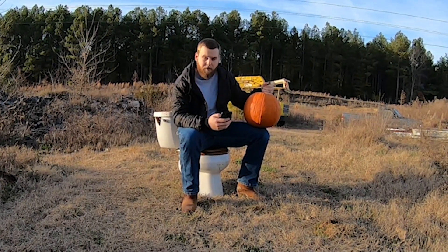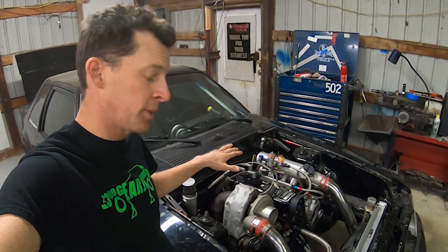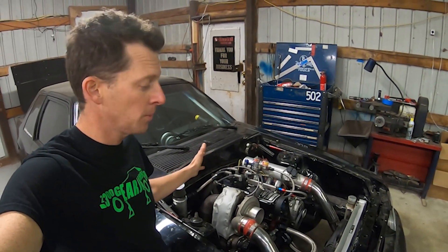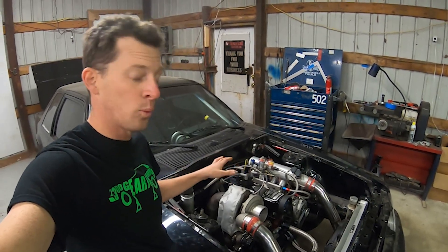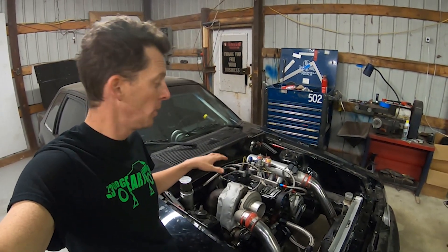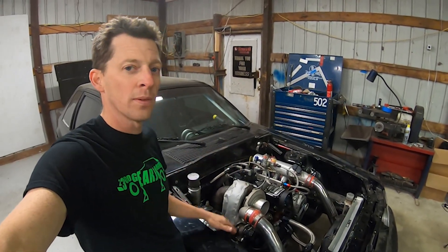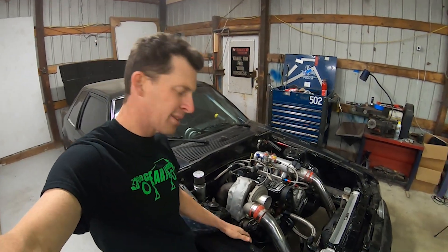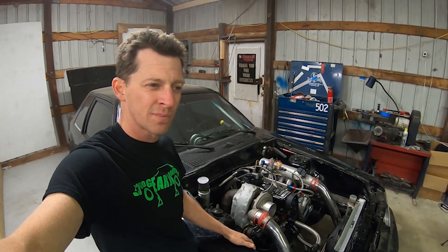Your Sister Mustang asks: if you move the motor back two inches, does it affect the driveshaft fitment? For the driveshaft I sent the measurement with the engine already set back — it's got a really long slip yoke. I've tried moving the engine forward with the same driveshaft and it works completely fine, just not optimal. Move it forward and I can run a stock Mustang driveshaft — it works out perfect, so I've got some options.